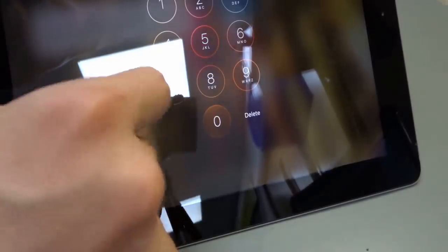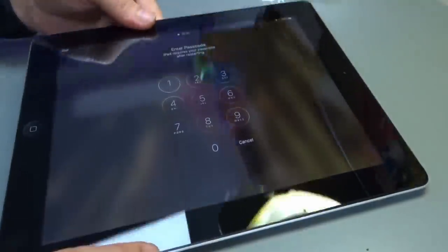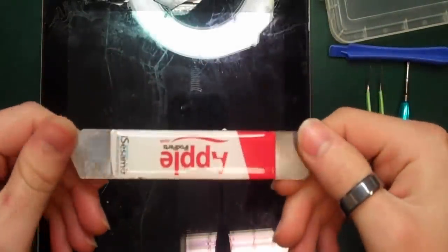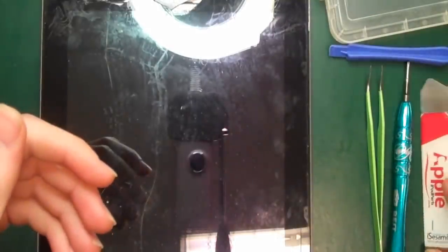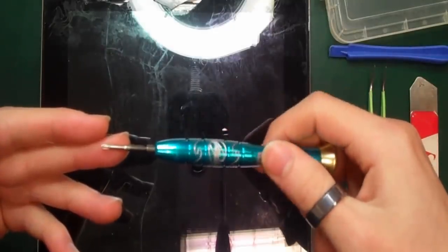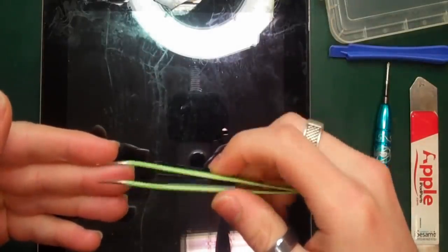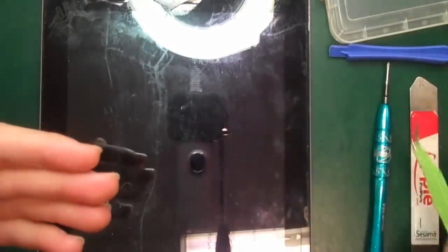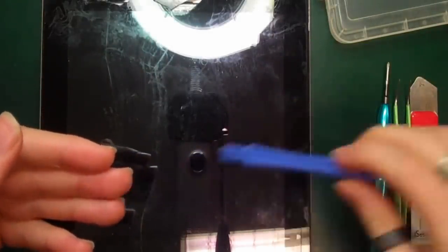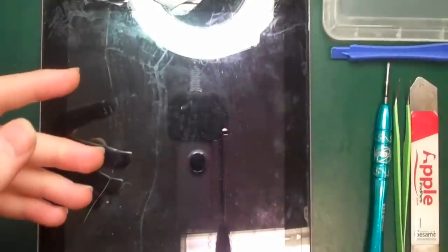Don't force it — that cable should just disappear between the LCD and the casing. Gently press all the way around. I can't emphasise gently enough: if you push too hard you will snap the glass. A nice little push all the way down the side, making sure it's flush all the way around. It should be flush, depends how clean you've got it. Powers on, and then we can start testing the screen. There we go — you've done it. Here are the classic tools: the iSesamo is absolutely invaluable. Also a little Phillips screwdriver, some tweezers, a plastic non-marring tool, and a screw organiser tray — all available at appleipodparts.com.